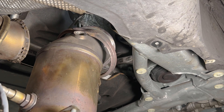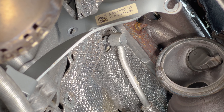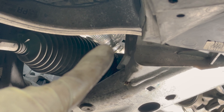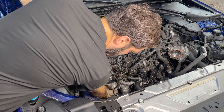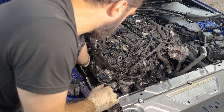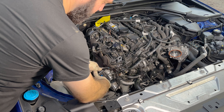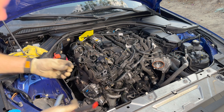Time to raise the car up now. Going to remove this splash shield here, continuing on to this cover — these are all 10 mils. I'm putting a tray under the car. Going after this line here for the coolant feed to the turbo. Coming after this downpipe clamp — 16 mil on this. The downpipe clamp is a 13, and there's a 13 bolt on the other side. To get some more slack in the exhaust, I'm going to take this 13 off. There was one T30 right here to pop this off. Some coolant dripped out — I didn't drain the entire block, so it only really lost a little bit. It took about a minute to drain.